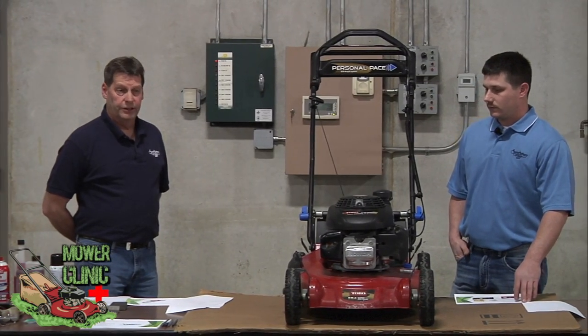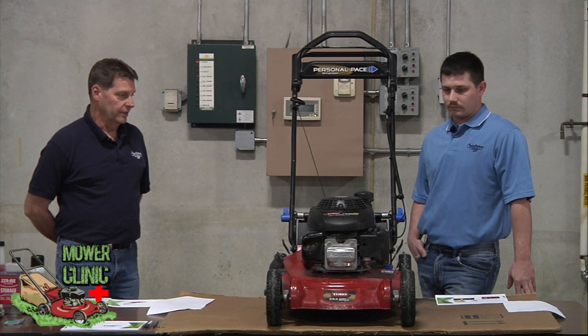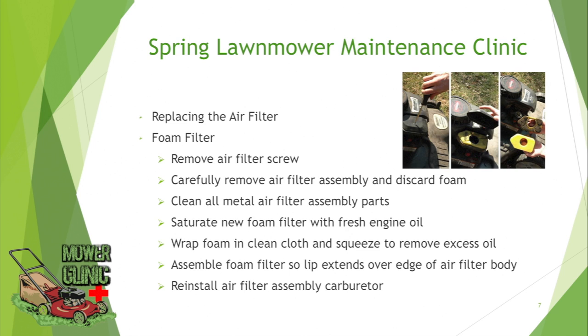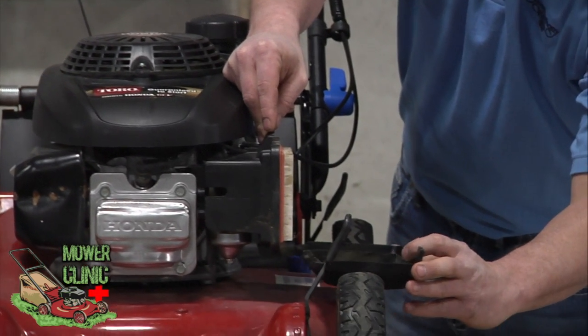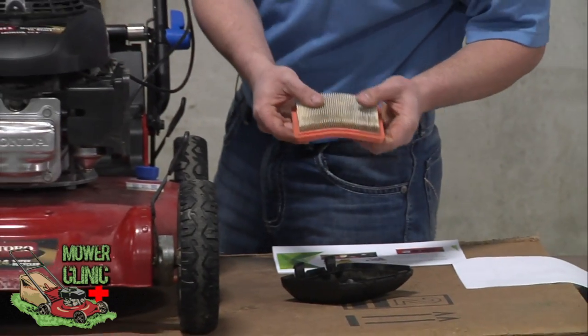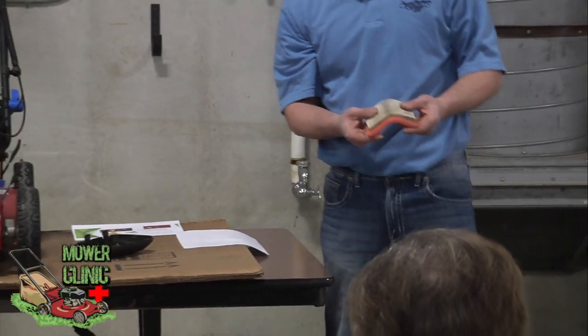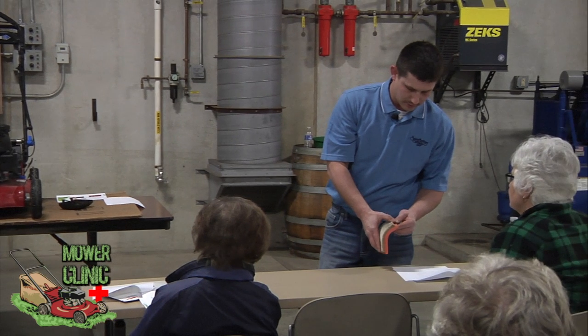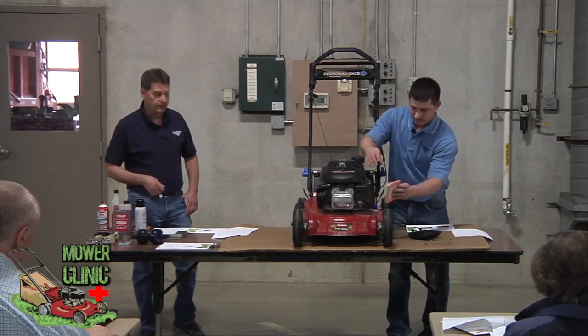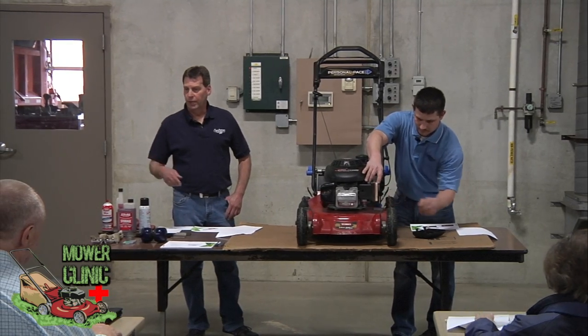We brought out a mower we haven't used yet this year — it was put away last summer and hasn't been started up yet. One of the things we'll go over is the air cleaner. There are just two little tabs on there. It's really important to keep that air cleaner filter clean — it's just like your car. If it doesn't get air it won't run. Pull it out and check what it looks like. If it's really built up, you can blow it out or tap it on a hard surface to knock the dust and debris out. Don't get the paper ones wet. If they're oil-soaked you'll probably want to replace it.